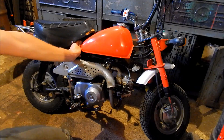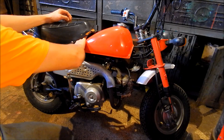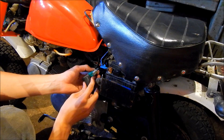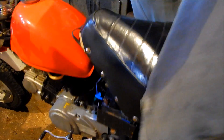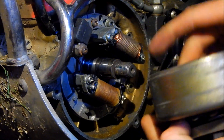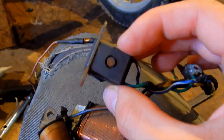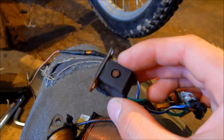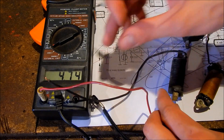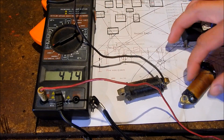It's mind-boggling that I built this electric system myself but I don't remember where anything is anymore. I pulled out the pickup coil and measured the resistance — it was giving 0.1. The spare part measured 0.32, so I'm going to change this coil to the new one.